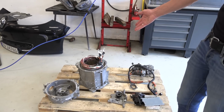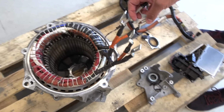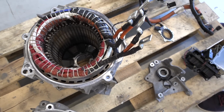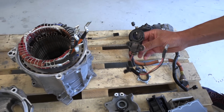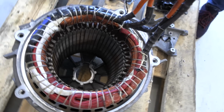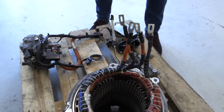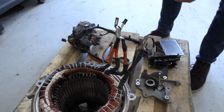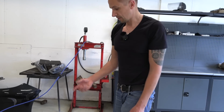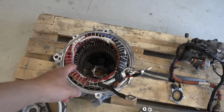So this is the Zoe electric motor taken apart. This is in a short circuit, and we have to send it to the company in Moss to rewind the motor. Brushes. But okay, something was kaput here. Yes, at least I got a message from the mechanic that he measured a short circuit between the phase and the ground. He said that the bearing was completely broken, and probably the bearing ball was touching, let's say, the anchor and the stator and made a short circuit. So this is the stator, but where is the rotor?